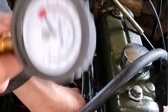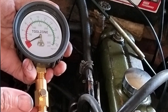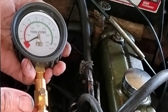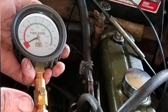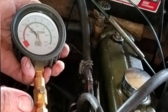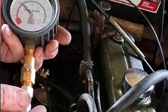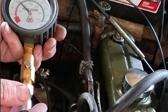I'm going to undo that and repeat it on all four cylinders, and then we're going to do a wet test on top. Compression test on cylinder number two. The readings can vary depending on how much you spin the engine, but as long as you spin it consistently each time you should get a constant reading. That reading is 92 — 92 PSI on pot two. I'm going to write that down.